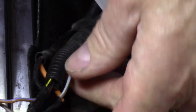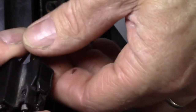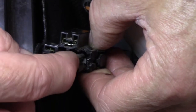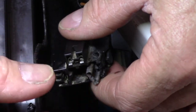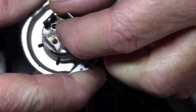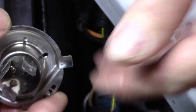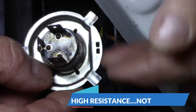Coming back here — which I thought might be the issue — if there were any problems with heat you would expect to find bubbled plastic over here. But that looks all good. So the main problem here is the actual connector itself going onto the globe. And of course, the globe blade that fits into this. I'm going to replace this connector. You can get this connector with tails attached, so I'll solder that in and replace the globe itself as well. Let's have a look at that globe. You can see on the back there's been a poor connection, which may have created heat onto that connector. That melted the plastic. To me, it looks like a poor contact on the blade, onto the globe, which in turn started the whole process — increasing heat, high current, and eventually melting that connector in the wiring.